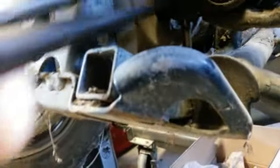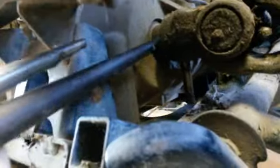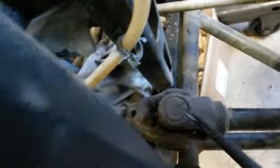First of all, you would think, okay, you can drive that pin out this way, but look behind that. You can't do that. It's going to hit that part there. See that? So you have to drive it straight down. And look at the long distance from there to there. So let me put you in my stand and I'll show you what I got here.